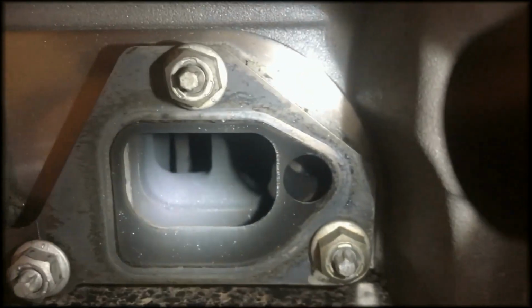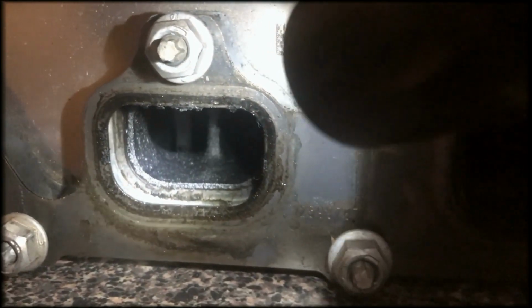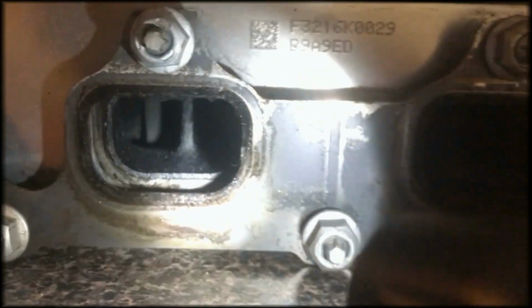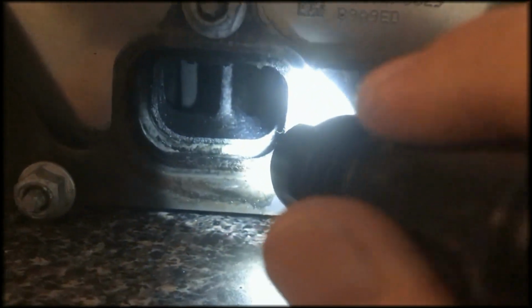When I was pulling the head out, I can see something in one of the exhaust valves. Okay, so signs are still there. So these are all dry, okay? So this is the first one. Okay, that's dry. This is the second one, it's dry. Third one was wet, you see that? And you can see the scoring also on the camshaft, and that's on the third cylinder, the exhaust cylinder. And you can see that one is dry. So this is our issue right here. We got to get that valve out. I bet you that's the issue with this engine here. There's a lot of gum in there.